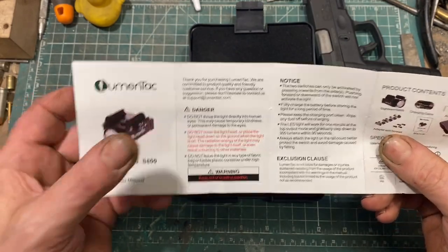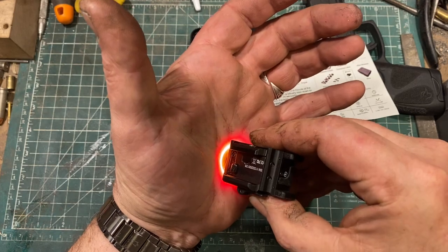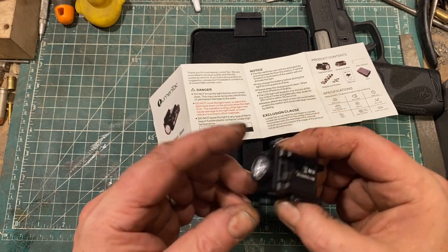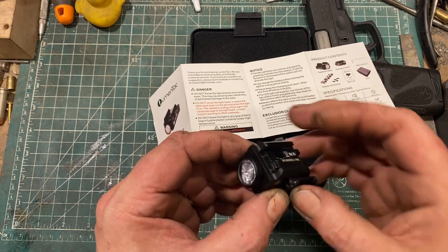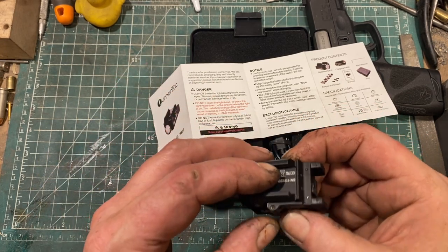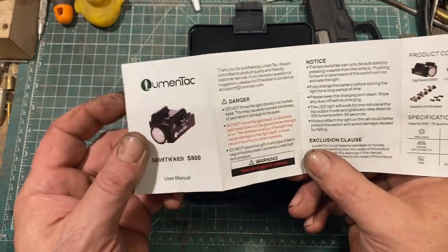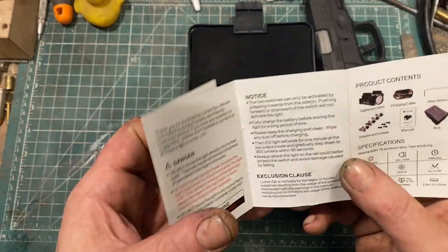The instructions warn you about heat because this is an 800 lumen light — it gets hot. If you press it against your skin at 800 lumens, you've got about five seconds before you really want to move your hand. I tested it by putting it down on a piece of paper and it did not ignite the paper before it scaled down to 300 lumens. After one minute, the 800 lumen light phases down to 300 lumens, which is why you can get up to 65 minutes. The manual also warns not to leave the light in a fabric bag or meltable plastic container because if it gets turned on by accident, it can melt them.